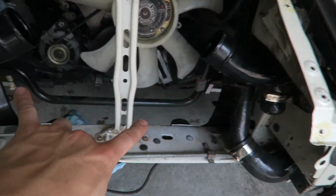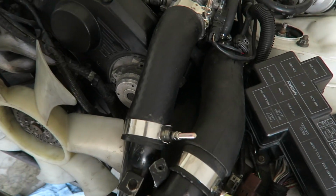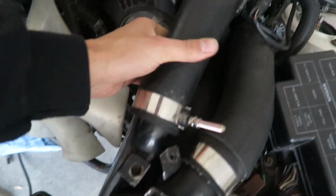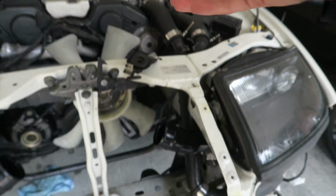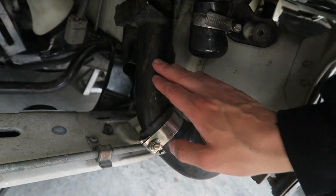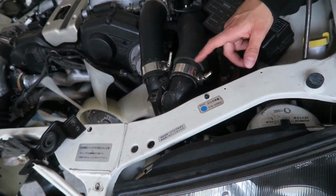Got the intake pipes on both sides. I got this intercooler side all plumbed, all routed and clamped up and everything. Just OEM couplers and OEM intercooler piping. It's kind of lame. I wouldn't do OEM piping, like small piping, and I wouldn't use clamps anymore. For a legit race car, I know this is an OEM twin turbo build, but if I was going full race car, I would definitely do custom intercooler piping and V-band clamps, because big couplers and clamps like this are pretty outdated as an industry standard.